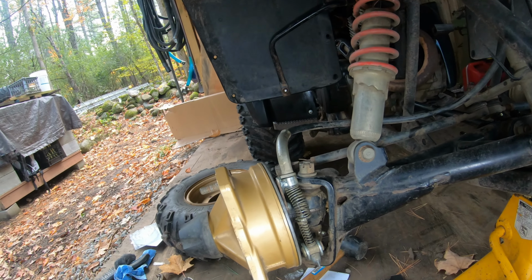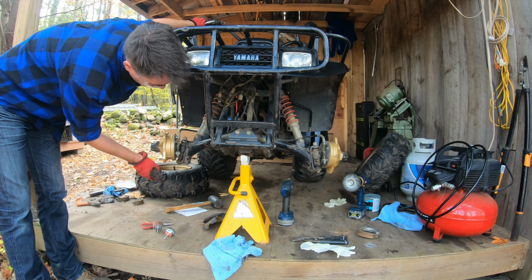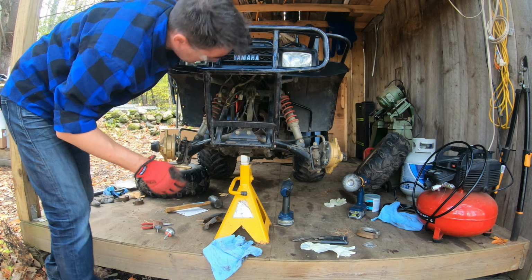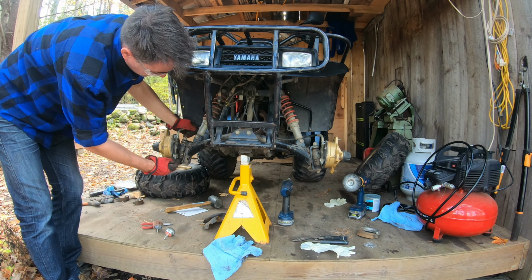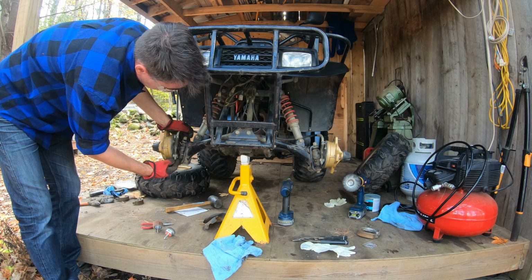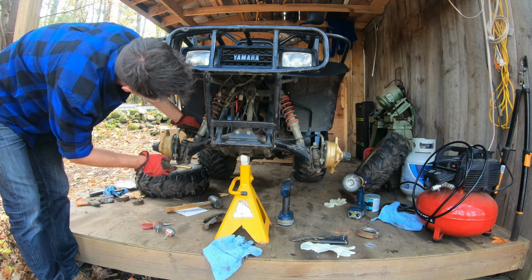Also, if I put the camera down, I'm gonna try and spin these hubs. Grabbing the brake. Not a real solid grab here. Not a real solid grab there. But looking up here, completely uneven. I need to balance out. So it's kind of as though this cable on the left is longer than the other one, or stretched. So that's a half, one and a half, two and a half, three turns.